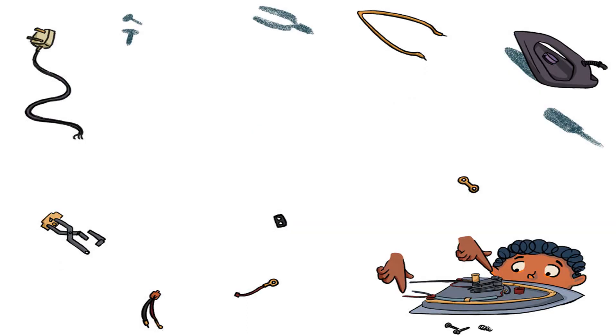'And this small thing is the thermostat. It makes sure that the iron doesn't get too hot. If the heat goes way up, it just cuts off the power — the red light goes out. When the iron cools down, the current flows again and the light comes on.' Other heating devices must work the same way, right? Geysers, kettles, ovens.